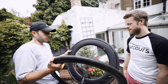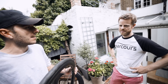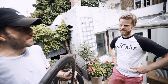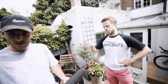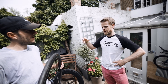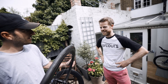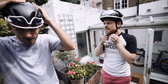These tires have not been ridden — probably never will be now. So what are we expecting to happen? I've had an accident in Mauritius where we over-inflated a tire and the whole wheel exploded and carbon went everywhere. I hope that's not going to happen here because I'm guessing that was a damaged wheel to start with. In theory, the tire should fail before the rim. If we do break the tubeless tape, you might get a little bit of rim inflation but that'll probably leak out. I'm expecting the tire to blow off the rim particularly for the hookless, and on the hooked one we'll probably see the tire bead fail. There is sealant in there.